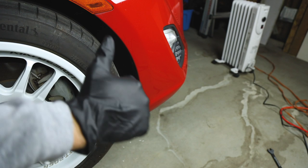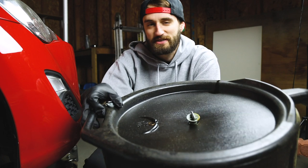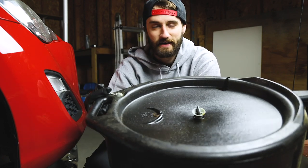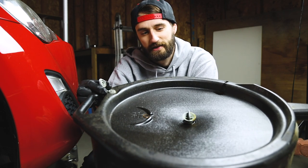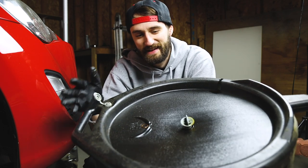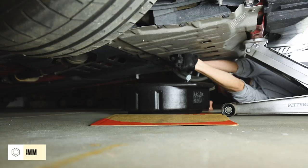Put on your rubber gloves and loosen the 14 millimeter drain plug. One quick note if you're using this style of oil drain pan: make sure you open the little air cap on the side, so that as the oil is draining in, air can escape through there. There was one time I forgot to do that and the oil just poured all over the side. The FRS drain plug is really short, so have your drain pan in position and be ready for a stream of oil.